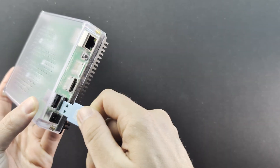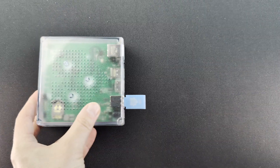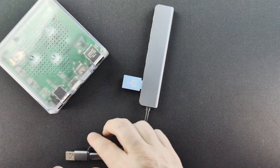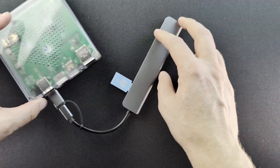First up let's talk about some of the good things about the Home Assistant Connect. To install it, you take the Home Assistant Connect and just plug it into one of the USB ports. I would strongly recommend that you use a USB extension cable or extension hub of some kind — that way you can avoid any interference issues that sometimes occur with this unit.